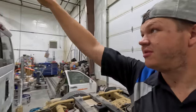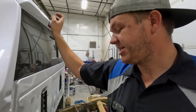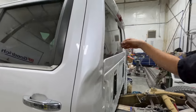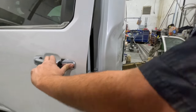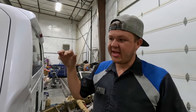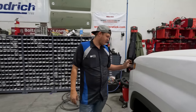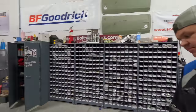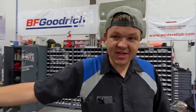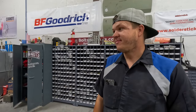On the cab I've got to take apart this upper panel because it goes over top of the cab corner. You have to pull the headliner to get this out. We do have to pull the back window — I'm going to talk to my glass guy and probably have him come pull it. We're going to tear down the back door, pull the back seat, pull the headliner. Side steps have to come off — we might be able to just retract them for when we paint. We've got to have the windshield pulled, that upper molding, and the fender. We're most likely going to take the bumper off, the grill, the headlight, all that stuff to get it repaired. By the end of the day I should have this ready for the insurance. The Dodge should be all done — my 2024 Denali is coming in next for wheels, tires, lift kit, new shocks, and Onyx upgrades.